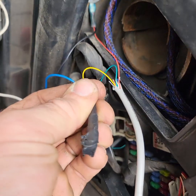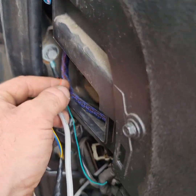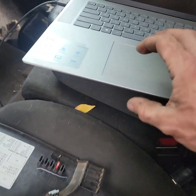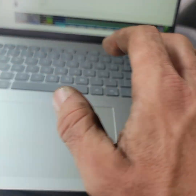You're wiring blue to pin two. You're wiring your ground off the serial — which is pin five — to a chassis ground of any kind. You plug them in. I didn't have to download any extra drivers or anything. It just read it and started working, which is ideal.